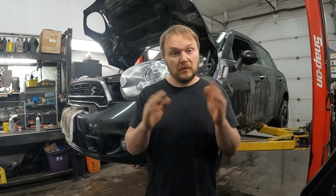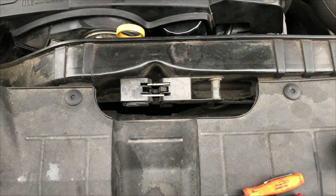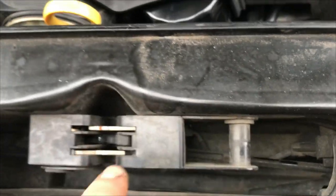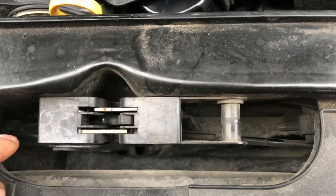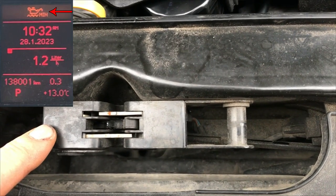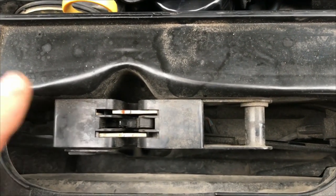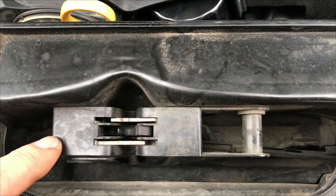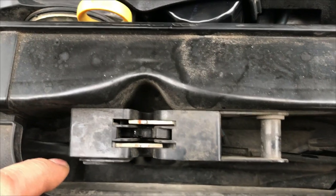We pulled it in — no surprise — it's still got the same light on. Then some Google searching, and wow, I found something that just seemed so out to lunch, but figured to give it a shot. Supposedly the contact switches in these, way down there, when they go bad they can cause that stupid warning light to come on for the engine oil. Weird. But when we open the hood, the light doesn't come on in the dash and no warnings come on. There's also some weird issues with the locking. So what the heck, we'll give it a shot.